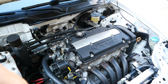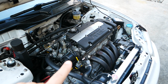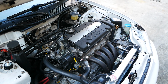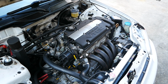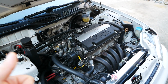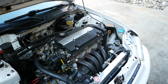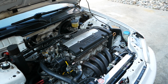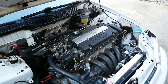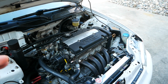So I told you guys the cams, told you who built it. The valve train is actually a tool steel retainer. It's a Ferrea +1 intake, factory size exhaust. They're both the 6000 Plus Competition, the highest version of the Ferrea valve stuff. The pistons are a custom Wiseco. Ended up at 12.95 to 1 or something like that. And the rods are Carrillo Pro-SAs. So an ultra lightweight balanced assembly.